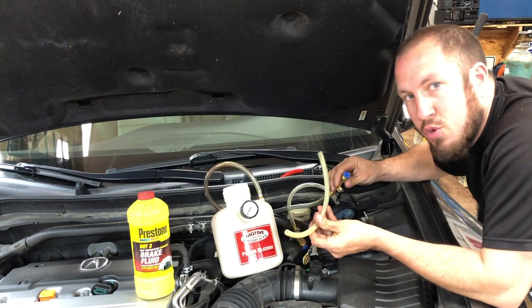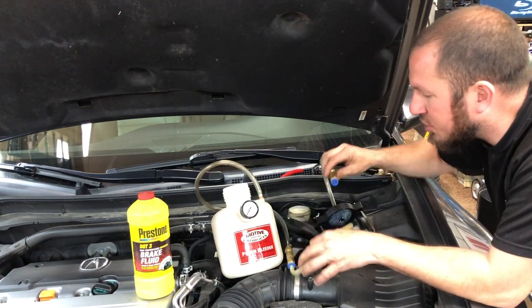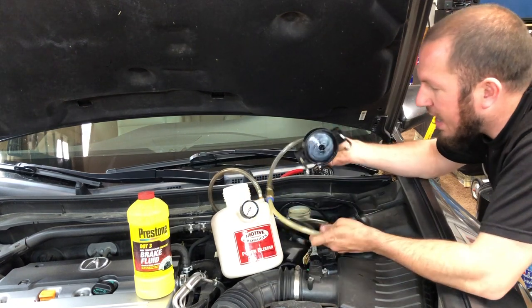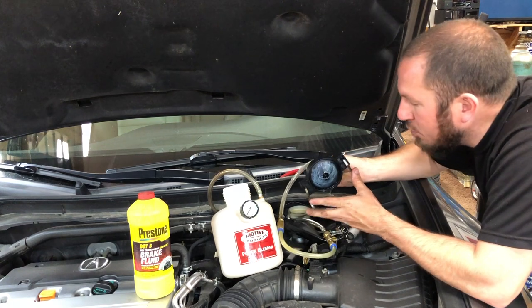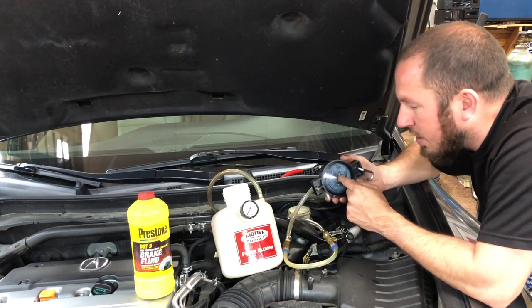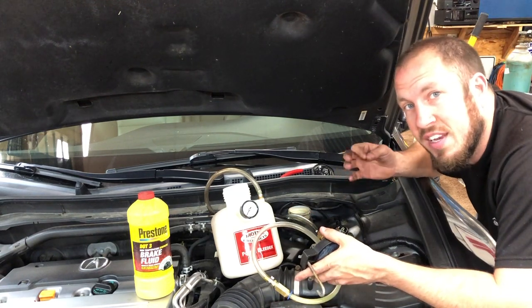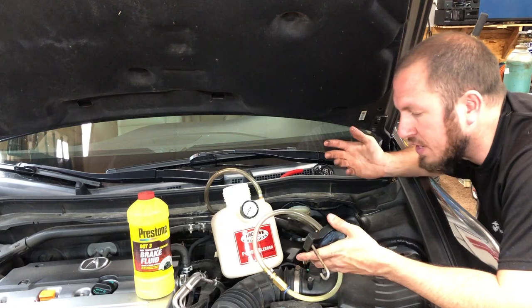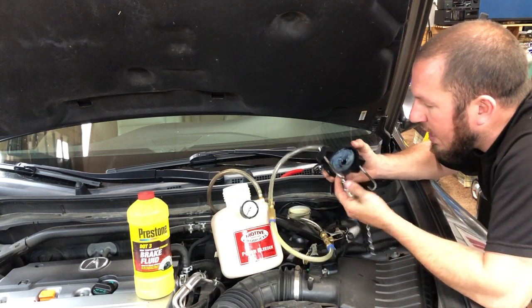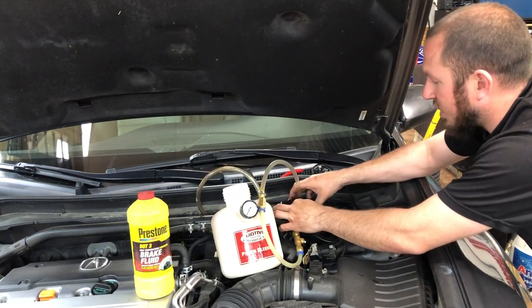I added a little patch hose in between because I use so many different attachments that I wanted to be able to quickly swap them over. I put two push-to-connect fittings on here, so now for brakes I can push my patch hose in and have the master cylinder adapter hooked up. A pro tip: I always keep some Vaseline or white lithium grease to smear around the rubber disc to make a great seal around the top of any brake fluid reservoir. The chain here goes around the body of your master cylinder and you tighten it down over the mouth — very easy setup.